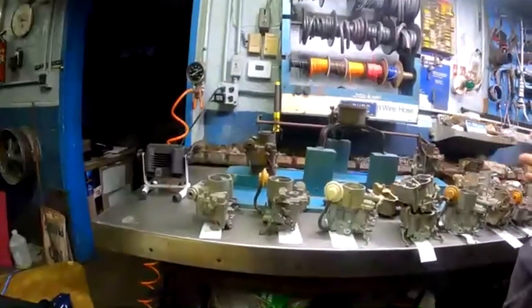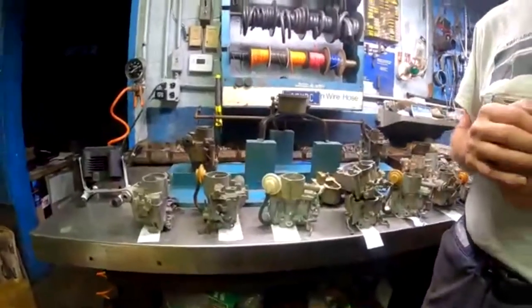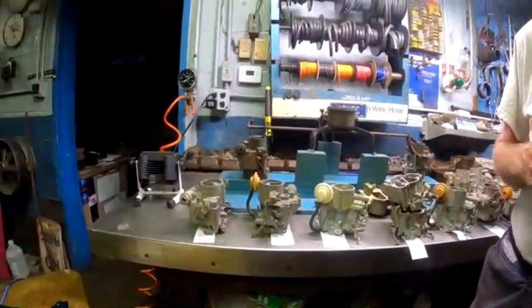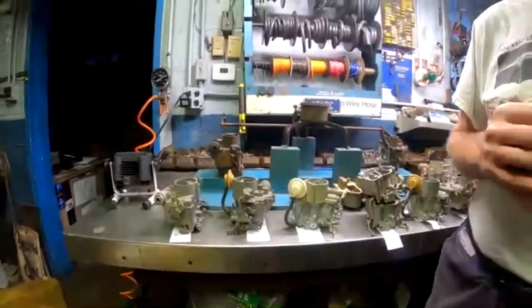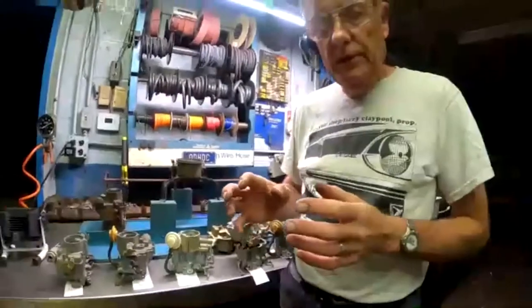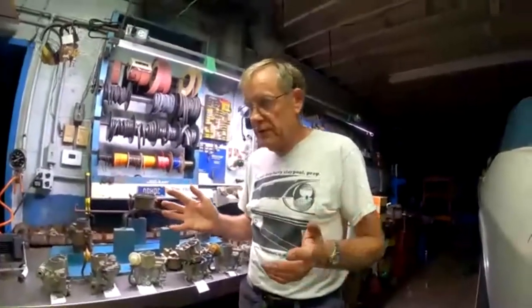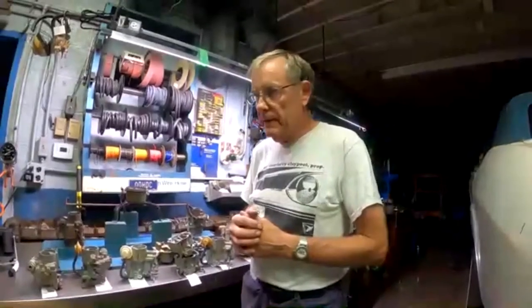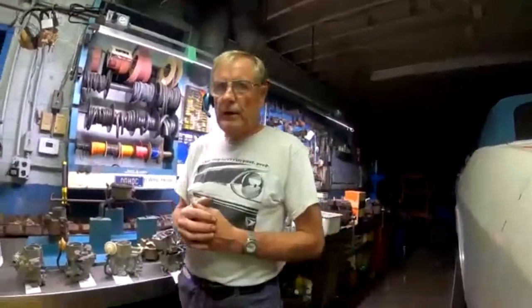Well, the other thing that the new recirculating air system caused in the Corvair was that the engine compartment temperatures were higher than they were in 1960. And that means hot soak became more of a problem. What's hot soak? That's when your engine's good and warm, you shut the engine off, and you go into the store or whatever for, say, more than 5 minutes but less than a half hour. And you come out and go to start the car up, and it doesn't want to start. You're cranking and cranking, the car doesn't want to start, and you finally get it started.